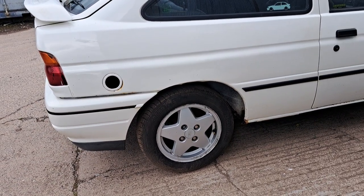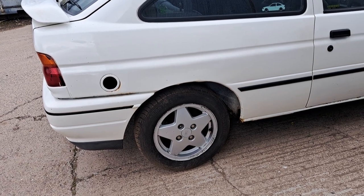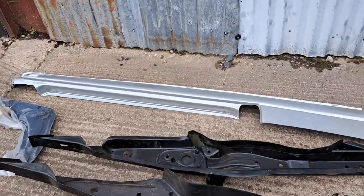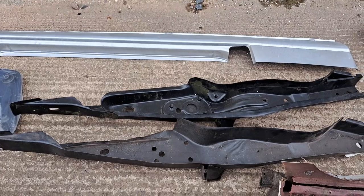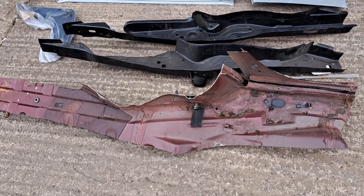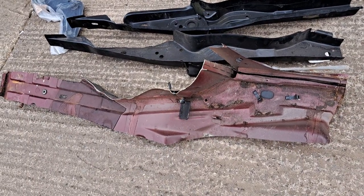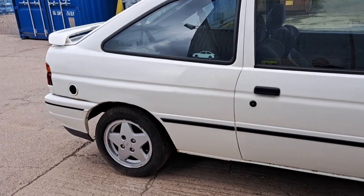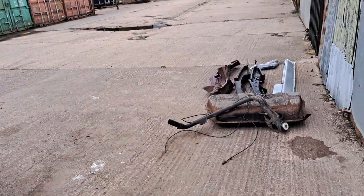Left and right side both were bad. Finding replacement inner and outer chassis legs was tricky. I managed to buy probably one of the last new old stock — cost me a couple of hundred quid — that is a driver's side outer and inner chassis leg, and I've got a cover. We also went to an end-of-life Escort and removed a good usable second-hand passenger side chassis leg. Simon was picking the spot welds out of the back of that Escort and was halfway through before we decided to call it a day.